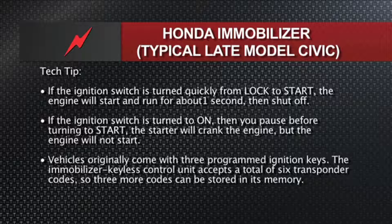When you have that lock cylinder in this little immobilizer exciter reader coil and you stick the key in and go to twist the key, when that ignition comes on, it's going to excite the little transponder in the Honda key — the little pellet with the radio transmitter — and then read that radio signal and send that upline to the body control module or whatever module is handling the operation of the anti-theft system.